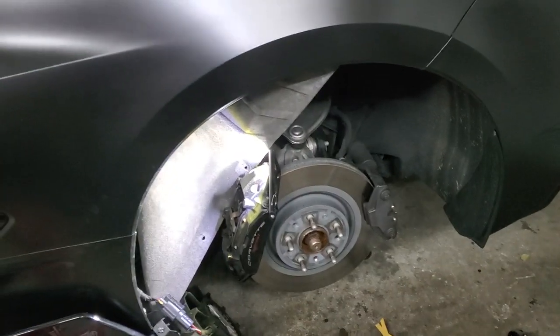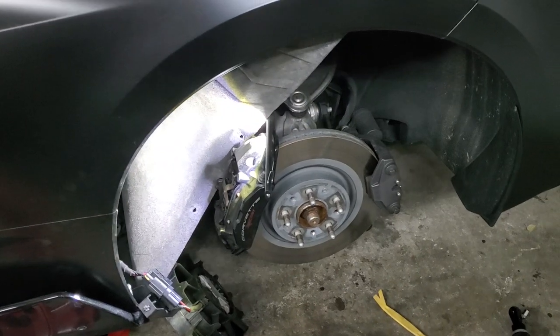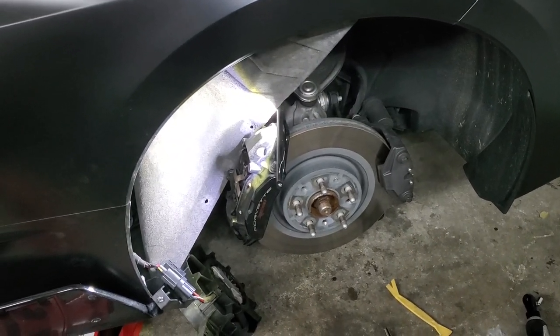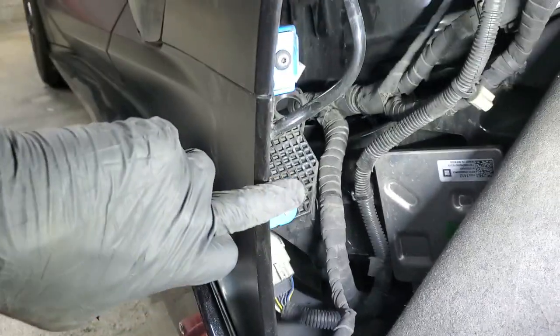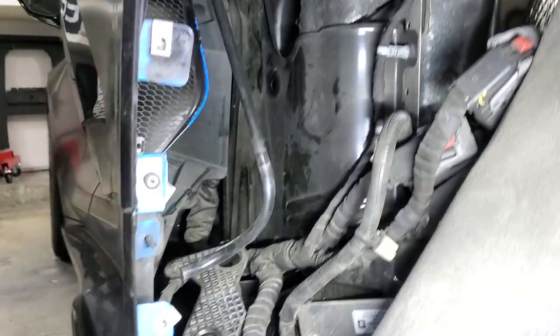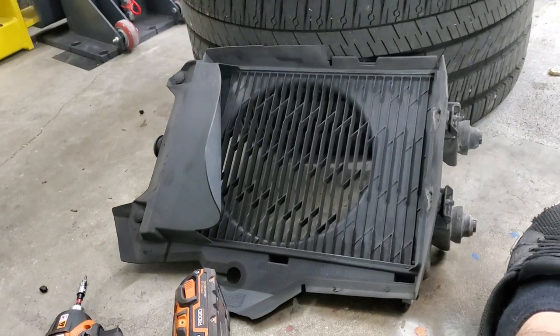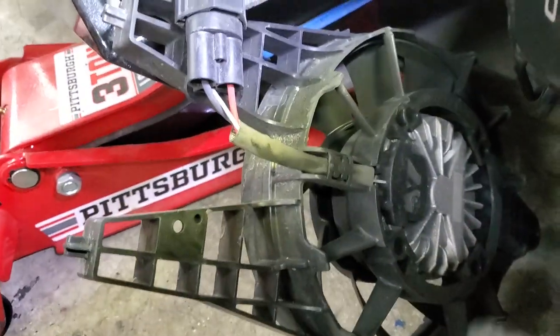There is still stuff you've got to get out of the way. Jack up the car and get the wheel off, then get the wheel liner off. Once you have the wheel liner off, there are going to be four T15 screws — one right here, two, three, and then a fourth one up top. Once you have all four of those out you can peel the wheel liner back or get the whole wheel liner out. Now you're going to have a couple of things in the way right off the bat. First you're going to have this big grill guard that usually sits right here — I already took it out but I'm going to show you — and then obviously you have the fan right here. I still have it connected because I still have the battery connected and I don't like disconnecting anything if the battery is still connected.